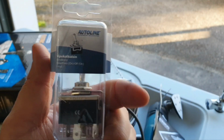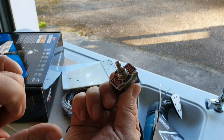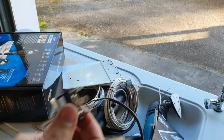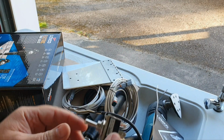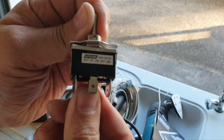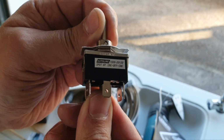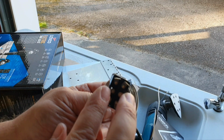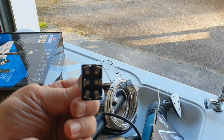But it means that it's not permanently on, so when you push it goes back, and we need this because we don't want to get stuck in that position. So on, off, on. But the most important, because this is the principle of the motor, you change polarity and it changes the direction. So the most important is that you need the switch which is called, can you see it now, DPDT, 6 pins. And then we have cross wiring here, plus minus here, and 2 ends to the actuator, to the motor. I will show you.